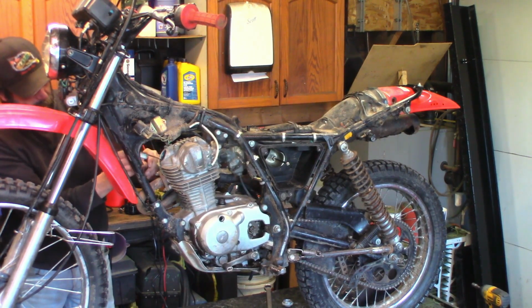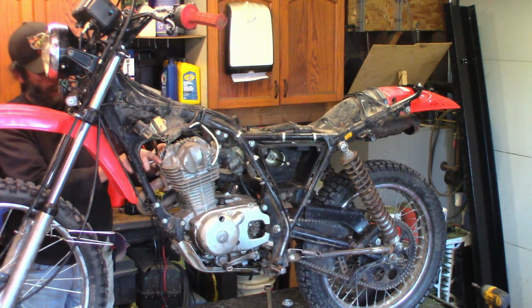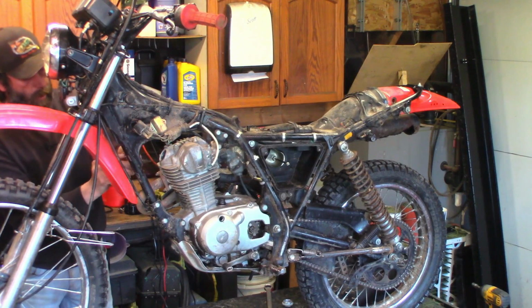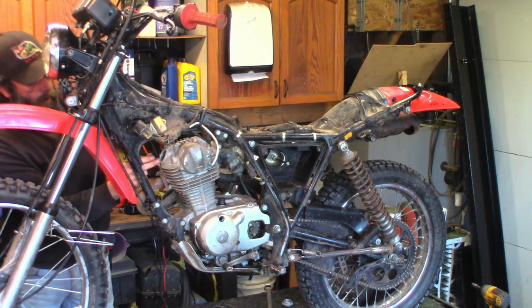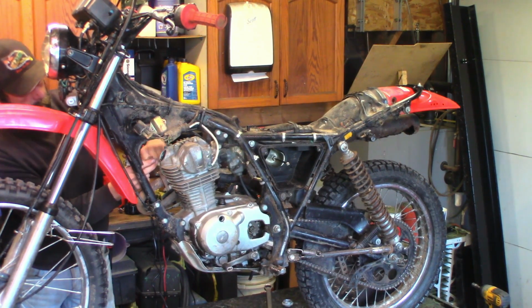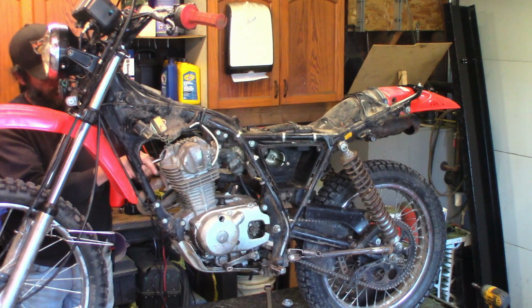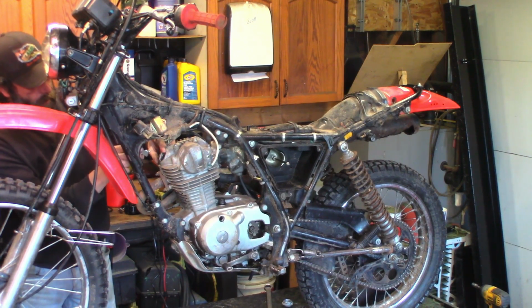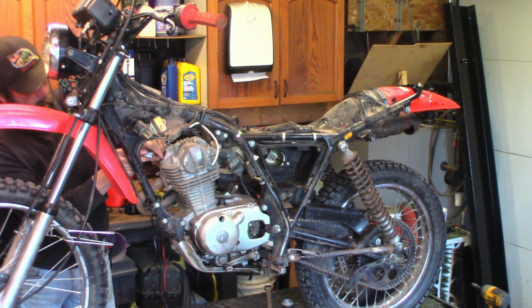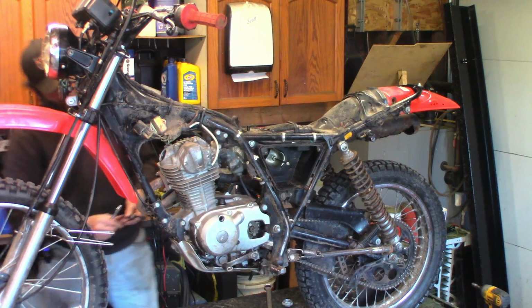That doesn't feel too bad. But things change when you tighten the nut up. I should be holding that screw in the center. Well, let's just see what happens. If I have to readjust it, I'll readjust it. No big deal. It's like right there. Perfect. I'm going to leave that as it is. Yep, the final torque on the nut made it perfect. That's 2 thou. So we took a lot of clearance out of that one.